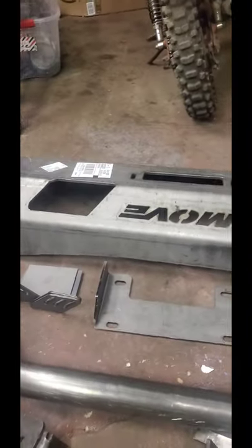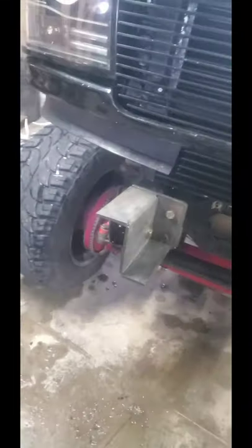Starting the install process: you've got to remove your old bumper, make sure everything's nice and square up front, then install these L-bracket looking pieces on either side. I left them a little loose so I can adjust further. Ran into a complication — somebody had welded the old bumper on before me and covered up the hole, so I had to drill out those third bolt holes. Got everything pretty squared up now.